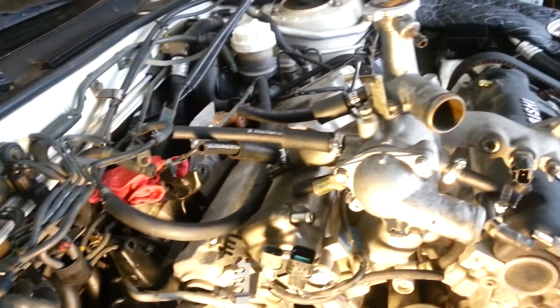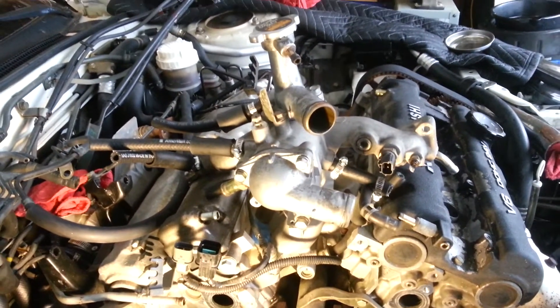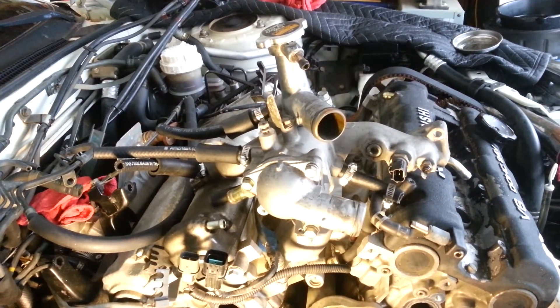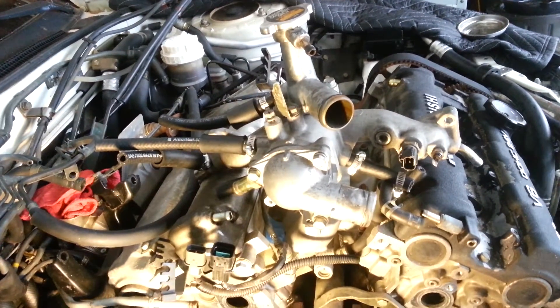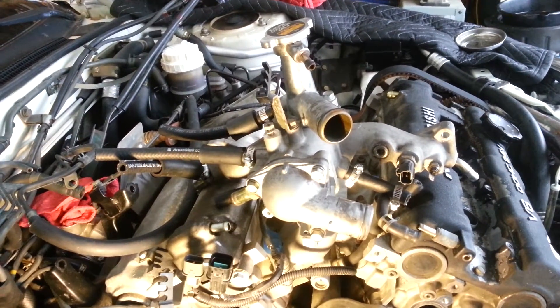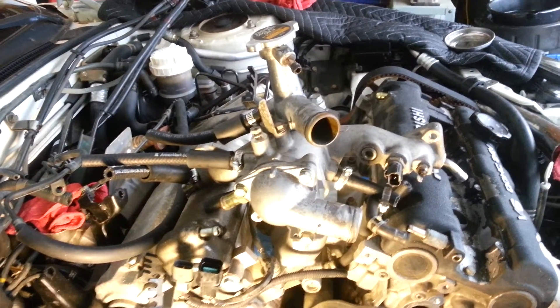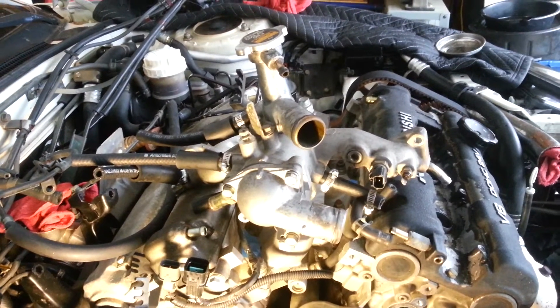She's ready to go back in. The other tip I can give you is when you do fill up the coolant system, make sure that you turn on the heater and have the fan running to avoid getting air bubbles in the system. It can be really annoying and sometimes a pain to get out. So that's the tip for the day.